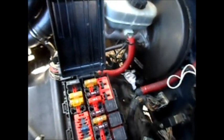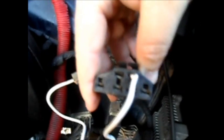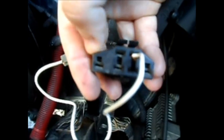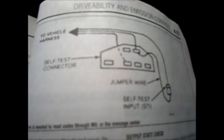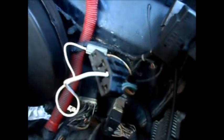I've switched over from the actual code reader to just my simple little wire that I showed you. And if you'll notice, when you turn the connector around, it is not symmetrical — this side here is a little bit longer on the upper side. The Chilton's book shows you to connect the little gray connector into the short side upper portion of the self-test connector. If you look closely, you can see where it's short on this side and long on that side, so it's all connected correctly.